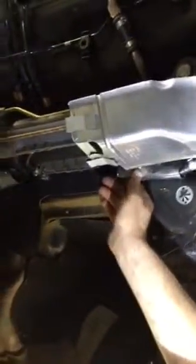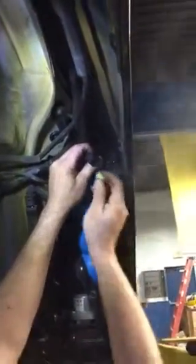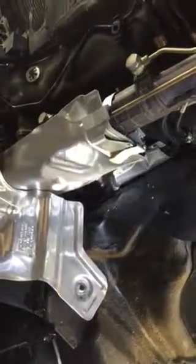There are plastic unions and plastic tubes behind here as well. I'm going to show the smoke test now with this cap pulled off to show you that smoke is coming through the hose, and then we're going to plug it. We got smoke — cap it. Look for more smoke, make sure there's no leaks. As you can see, the lines aren't cracked and there's no leak.